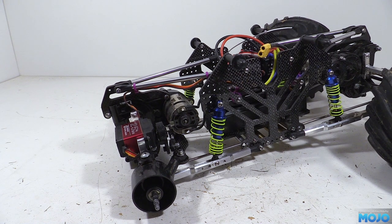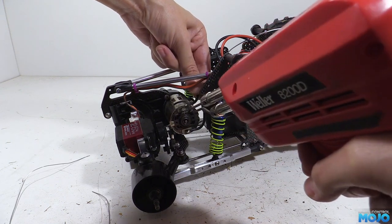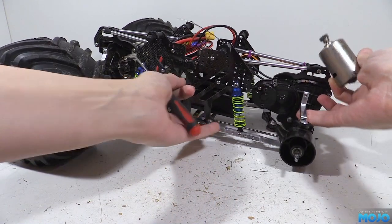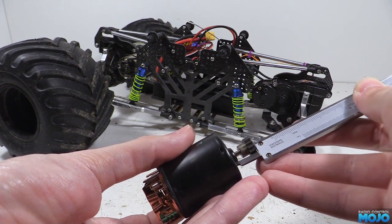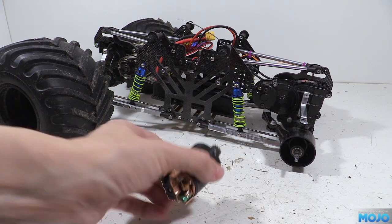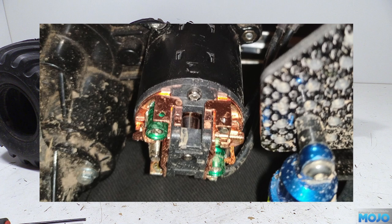Let's play with the new motors. First we need to remove the leads from the old motors - we just need to heat them up with the solder gun and take the leads away from the terminals. Then from the other side, undo the two motor mount screws and remove the motor. Due to technical difficulties, here we have the pinion from the old motor fitted to one of the new ones. The main thing I missed was measuring the distance between the outside of the pinion and the face of the motor to get the pinion in the right spot. On the clod axles with the cover on, you really can't see the pinion to set the position, so it's easier just to carry it over. Also, I noted that these motors are set to zero degrees forward timing - noting the timing mark on the end bell is in line with the gap between the magnets. There's a rather good video from Holmes Hobbies that covers timing in far more detail - I'll pop a link in the description.